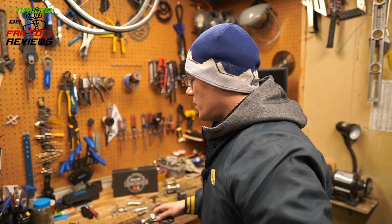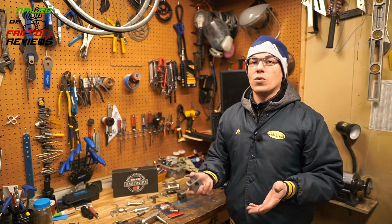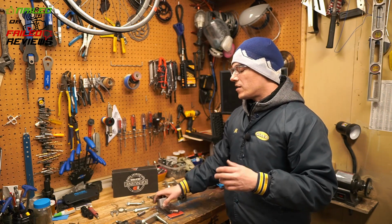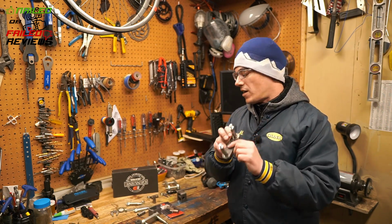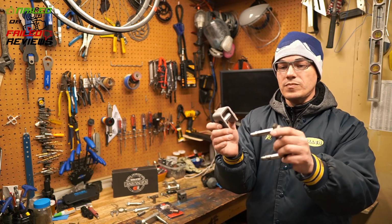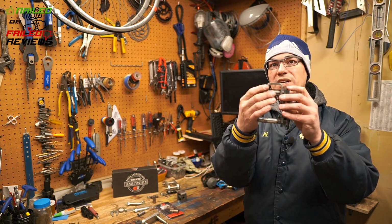Again, depending on your brand of trailer, you're definitely going to want to get under there. Really, the only way that you can figure this out is by taking the wheels off, jacking everything up, and taking apart the hangers to see if it's worn away. Now, you can look in there and see if your hanger has this insert like I showed you. You're either going to see a bolt or you're going to see a split insert.